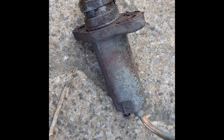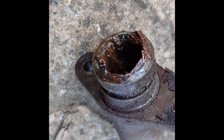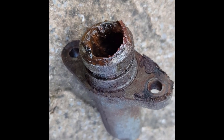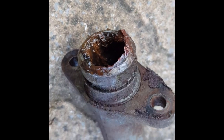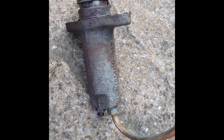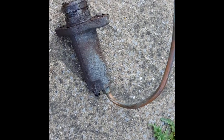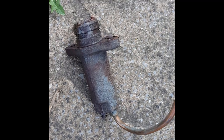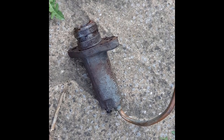That's it, it's off — and it's not in great condition at all. That's pretty bad, it was well past its best. We left the pipe in the end; we undid the pipe at the master cylinder end. Not sure about this pipe — I might see if I can get another pipe made up in flexible material. A solid pipe with a cylinder that will move relative to the chassis doesn't sit well with me.